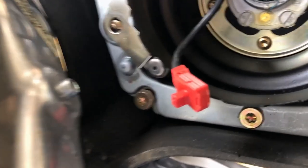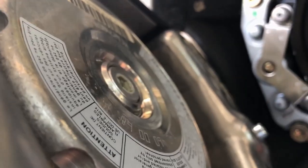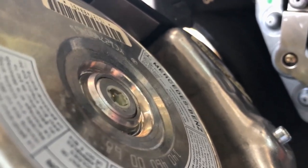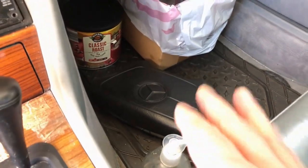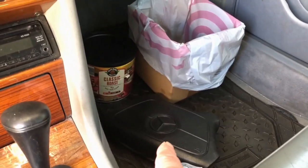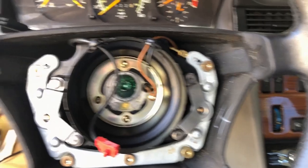Of the airbag, there's little plugs, two pin, and I just stuck a little tiny screwdriver that I had under the side of it. It'll pop right off. Couldn't get it off with my fingers. Now it's safely off, padded side pointing up, in case it decides to explode, it won't be shooting metal everywhere. It'll just have a big old bag. Isn't that just wonderful to think about?